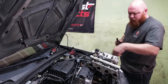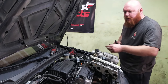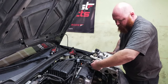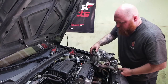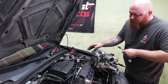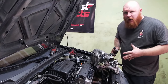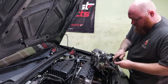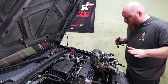And as far as the return fuel, I'm just gonna block it off, and then later on when we put the turbo on, we got big injectors, big fuel pump, I'll do a budget return system. One thing about this one is it came from an automatic, so it actually has an idle valve, and the connector looks very similar to the OBD2 style, the newer kind, so I'm gonna try that out, hopefully it fits. And then I'm gonna reuse this throttle body because I want everything just as easy as possible. So I actually got some adapters that connect the older style to the newer. So these should be plug and play, nothing to worry about.